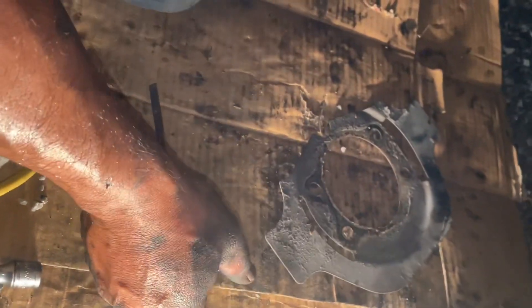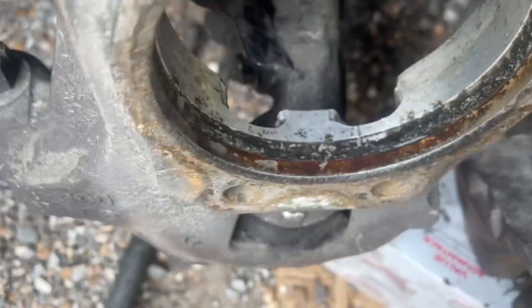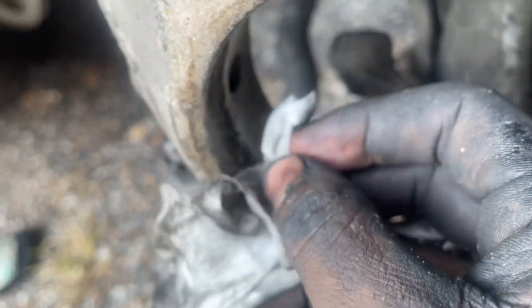After this, just wipe down the surface — make sure you have a clean surface to put the new one. Wipe down the hole where the ABS sensor goes, the wheel sensor. Clean it, like I said. And there's me — not hanging up the caliper for some reason, just using the box to support it. Right there, you see that's the 10-millimeter I was talking about. I'm wiping it down, cleaning the surface and the hole for the sensor.